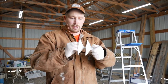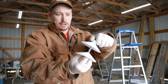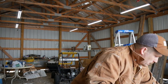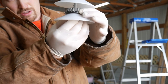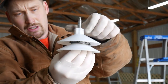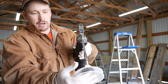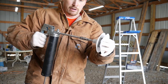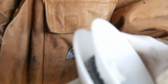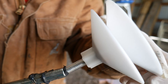We brought it into the barn here since it was pretty windy out. This little tool right here is what you use to pack the bearings — it's pretty nifty. You just unscrew it, it comes apart, you put your bearing down on here, and you screw it back together. The bearing is pinched in there. Now you take your grease gun, put it right on top — it fits right in there — and you pump it until grease squeezes all the way out of the bearing.